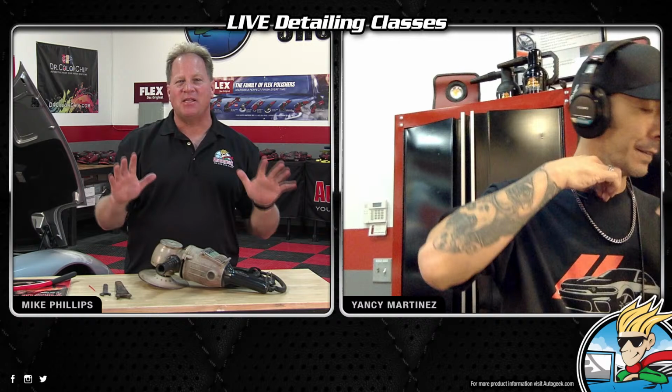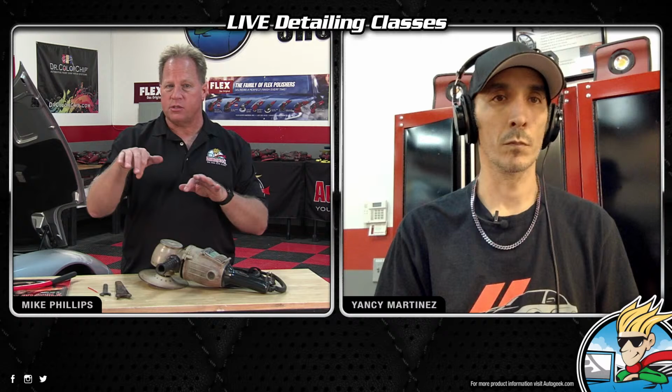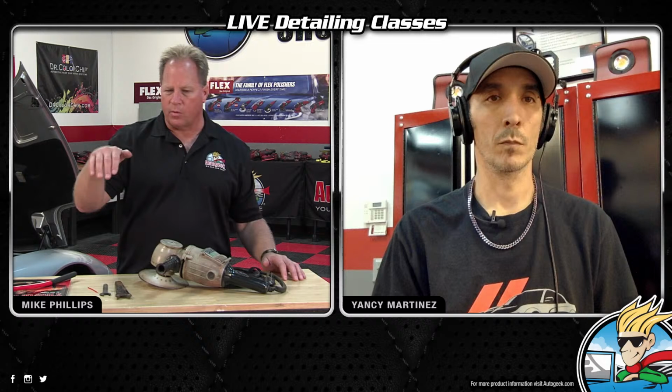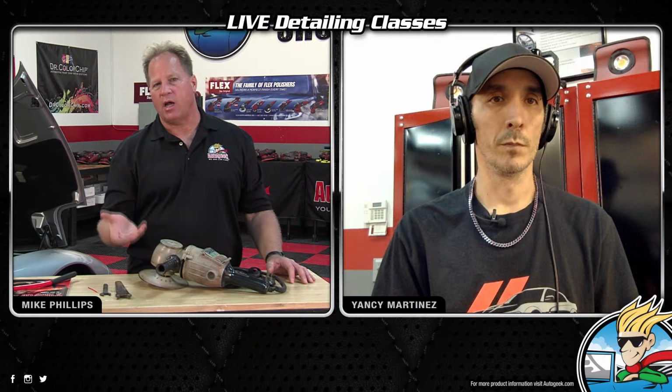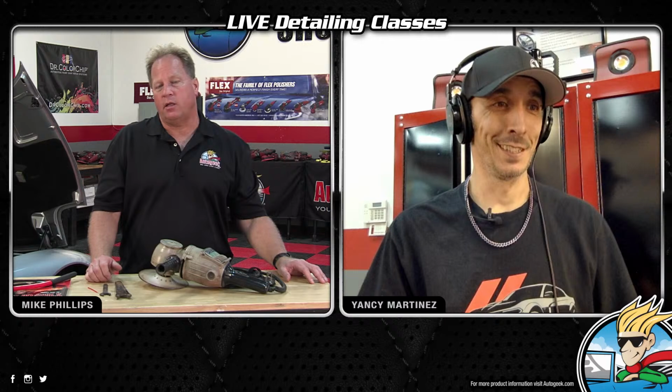All right, let's go here. Sarah, what's the best way to get pitting off of chrome rims? You can't really get pitting off chrome rims. A lot of people think chrome is impervious or impermeable, but it is actually permeable. It's porous. And what most people don't do is clean their wheels good enough, especially the crevices, the seams where the spokes would be or whatever the design may be. They get the easy to clean areas, but wherever dirt can get trapped, it builds up, becomes a film, and holds moisture in. The moisture gets behind the chrome layer, rusts the steel, which starts to expand as it's corroding, and it pops the chrome open. There's nothing you can do to fix it. Just clean it really well, stick a fork in it, call it done, kick it out the door.